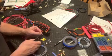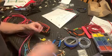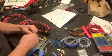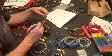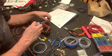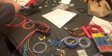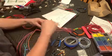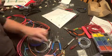And then the really sharp ones here, you'll notice I did these out of order. I've got 3 wires there connected together, and that was going to be for the next fuse, which is the mass airflow and 2 oxygen sensors. So that's why that has 3 wires instead of what we need for the transmission. Beginning to see the process. You just take each one in turn, label your wires as you go.